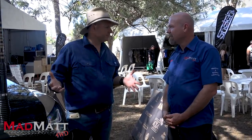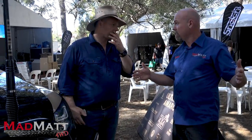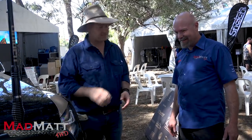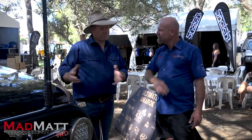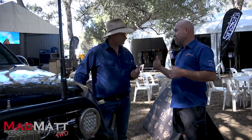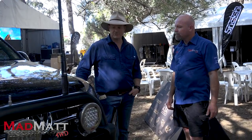The first thing we did was actually extend the chassis by 650mm — that's a good two to three feet. It doesn't sound like that much, but when you see where that back wheel goes way off the back, it changes things a lot. When it comes to load carrying, putting the back wheel back there in a dual cab is smart, because modified dual cabs with a decent load tend to throw the weight too far back, and we see those guys cracking chassis, especially when they start towing.